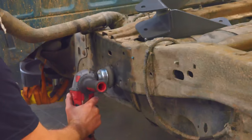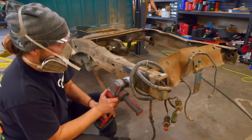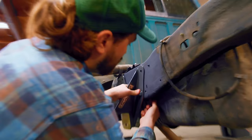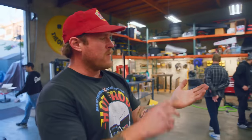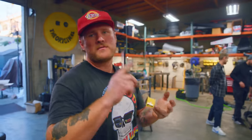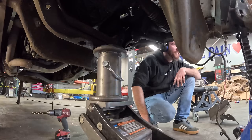While they're working on the front, I'm going to get to working on the rear. I'm going to clean some things up with a wire wheel, and then install the leaf spring pickup points — they bolt into existing holes on the frame. I'm also making a list of all the hardware we're missing: tabs, bungs, shock tabs, bump mounts, everything like that, so we can order it all tonight.